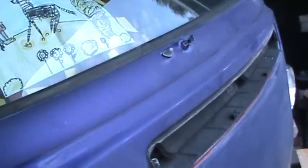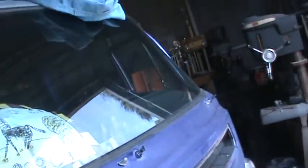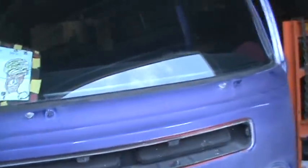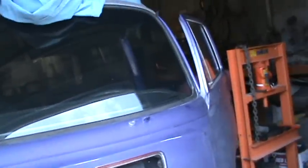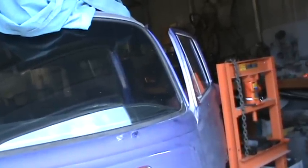It's very important to flip the rubber up, make sure there's no rust starting under the rubber, and there's no rust under the glass, because like I said, this could be an area that can be troublesome, and it has to be addressed if it's starting to rust there, because it compromises the seal on the windshield, and then the water starts getting into the bus and the rust starts getting to the floor and everything else from there.